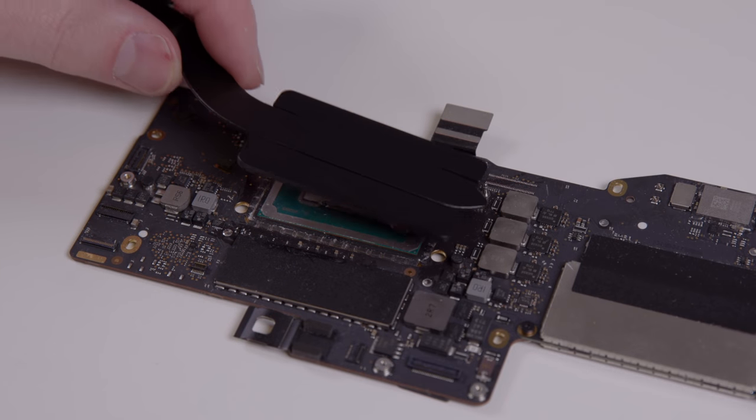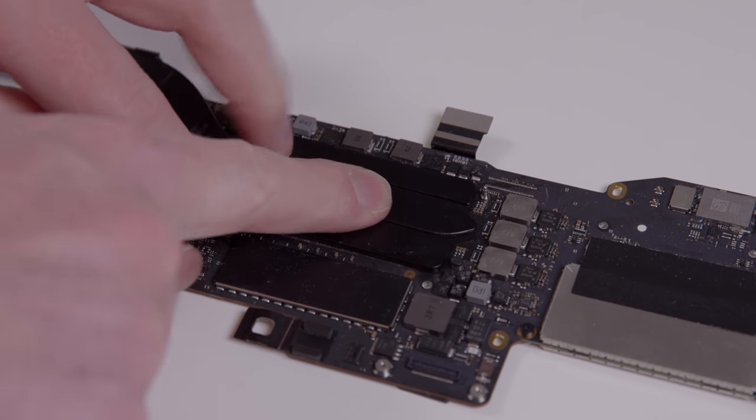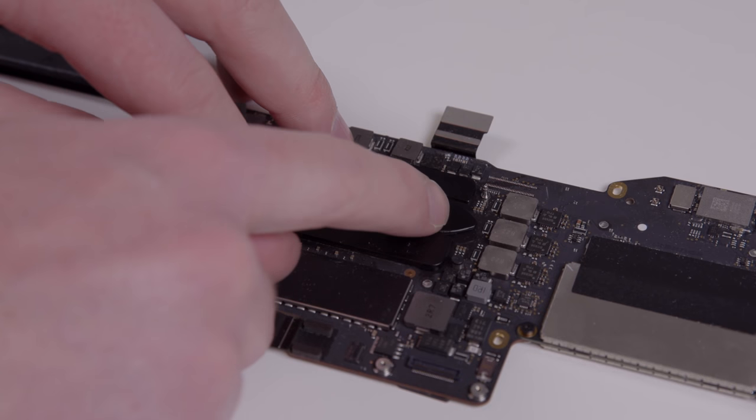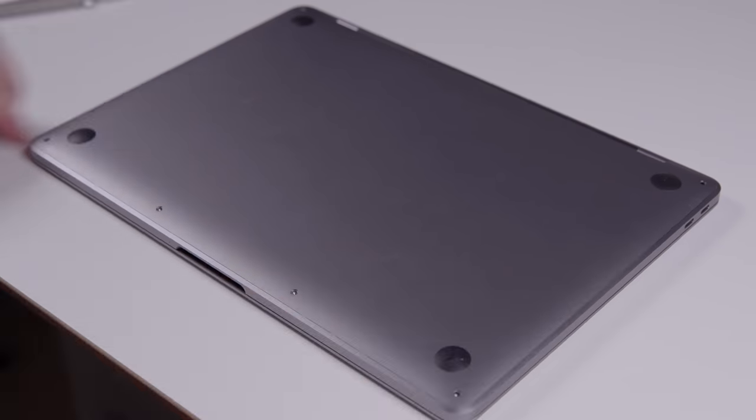Confession time. While I've liked the idea of having liquid metal inside my laptop, it really only provided an improvement of about 7% over a high quality thermal paste, which is much lower risk and doesn't require annual replacement. So I just decided to settle and put in standard Arctic MX2 instead and not have to worry about it. You'll still get a 7% to 10% improvement from the stock Apple paste job, and you'll save money and stress in the process without any damage to your computer.